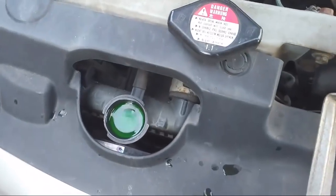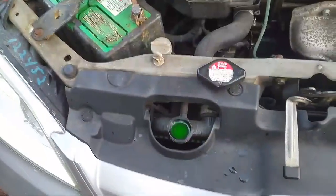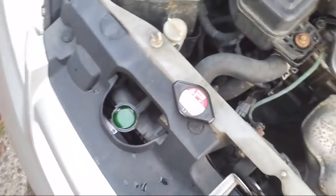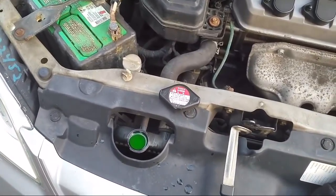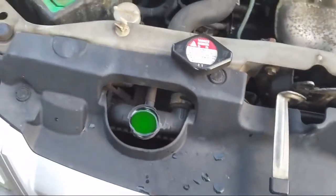These are the radiator hoses right here — you can squeeze these and get some of that gas out. I'm not trying to do it too much, I don't want to spill all this coolant. My allergies have been acting up bad. I had to bite the bullet and spend about $35 on Claritin, a 70-pack of them. That's getting a little high. I'm going to turn the heat on just the first notch — that helps it go down and might help with the burping process.